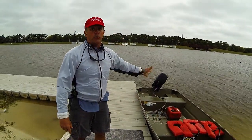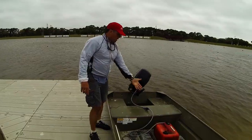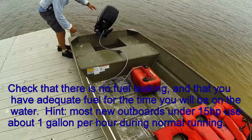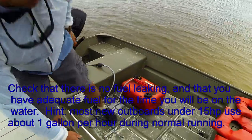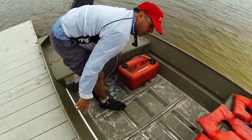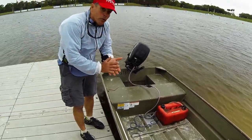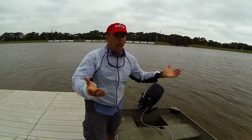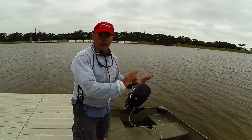It's always good to have at least one PFD for everybody that gets on the boat. Normally there are three people on a launch when using it, but many times there's only one. You also want to look at your fuel tank — make sure there's no leaking and that the connections fit snugly to the motor and fuel tank. Make sure your fuel tank is full before you go out. I've seen many launch drivers start a race and by race number three they're out of fuel, which becomes a logistical problem and can mess up a regatta.